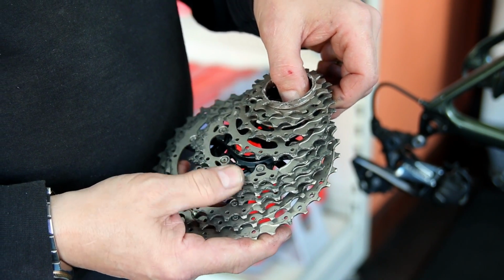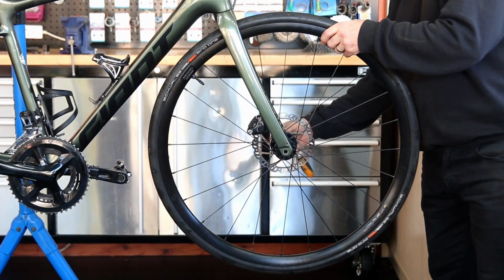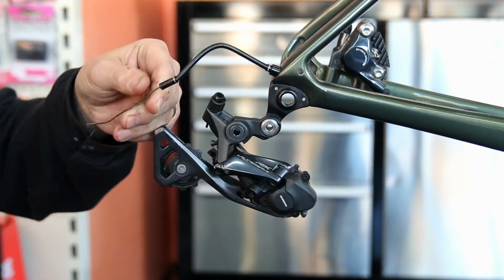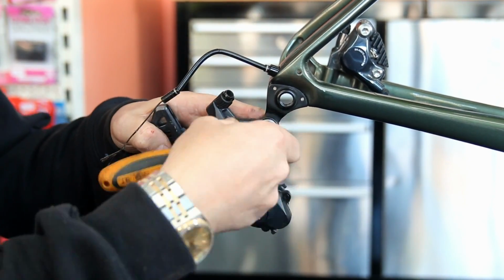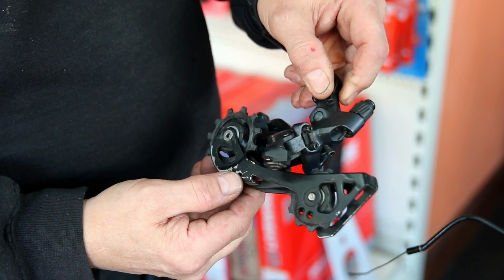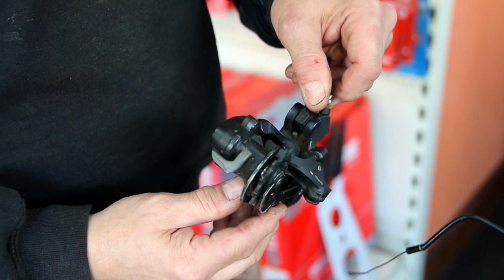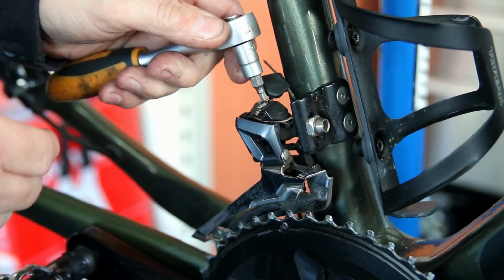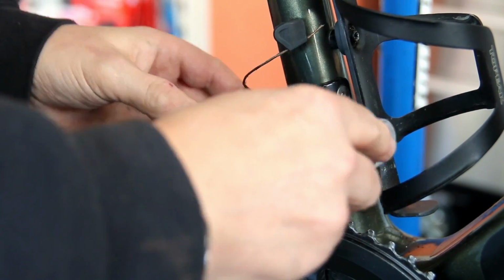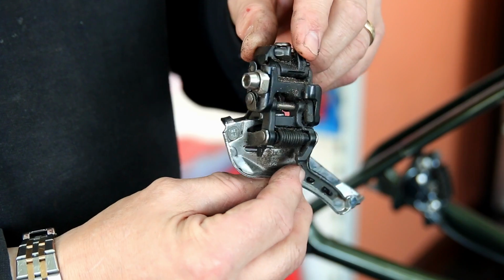So even though the bike was in great condition, we treat all bikes the same in that when we're servicing them, we remove the mechanical parts, we assess those, we weigh up which ones we're going to in-depth clean and which ones we're not. But typically the derailleurs we put through the ultrasonic cleaner anyway because it gets so in-depth. At ultrasonic wave level, the agitation of the debris that's tucked in that you cannot get to with a rag or a brush, it just makes the world of difference to the components. So that's what we're going to do.